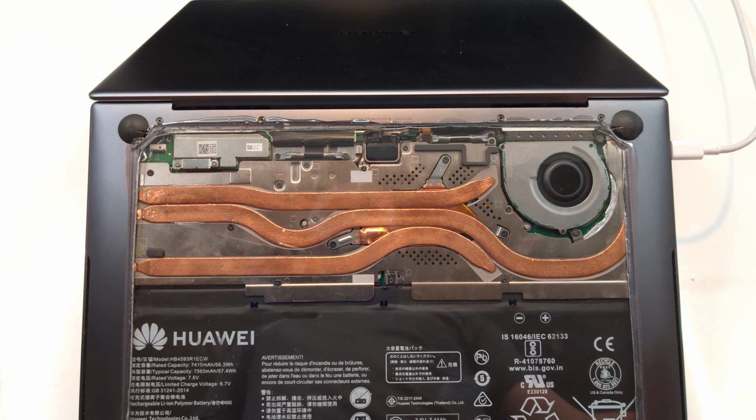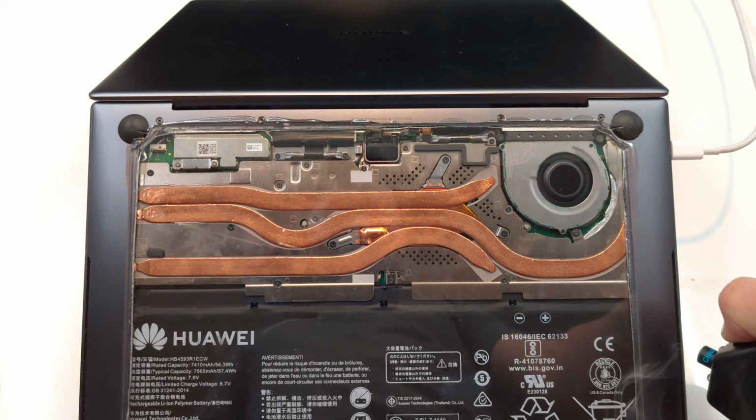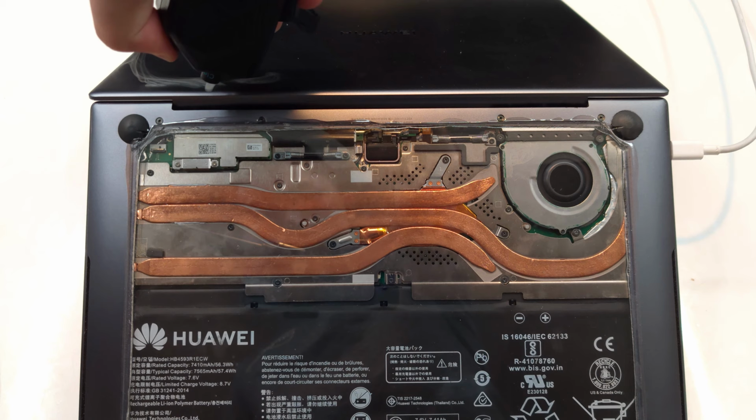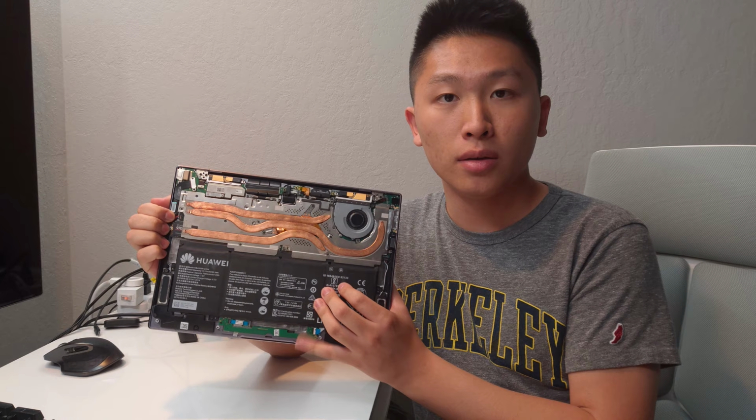So we see a few problems with this setup. First, not all of the air actually goes across the heatsink. Second, the airflow is pretty slow compared to especially the exhaust of the fan, where most heatsinks would be located. Third, the airflow is very smooth. That means it's laminar flow instead of turbulent flow. You actually want more turbulence to have more heat transfer with the air. It's just not a very effective cooling system.